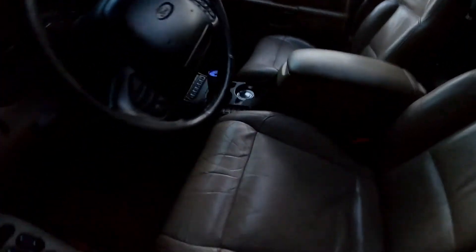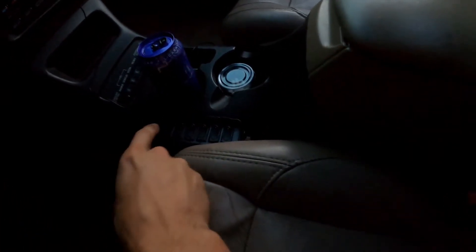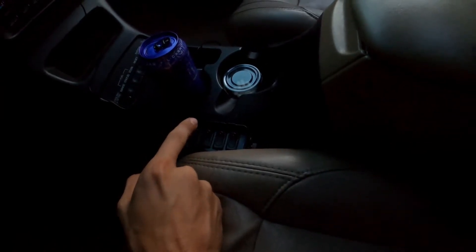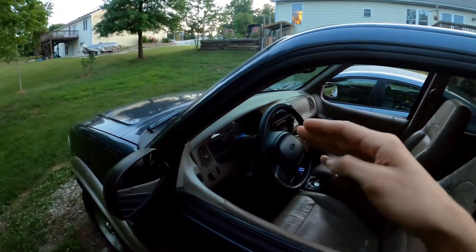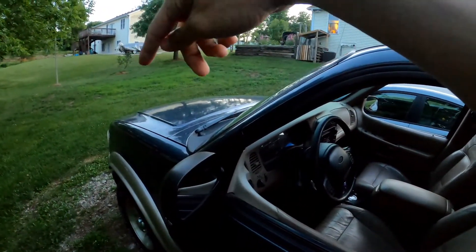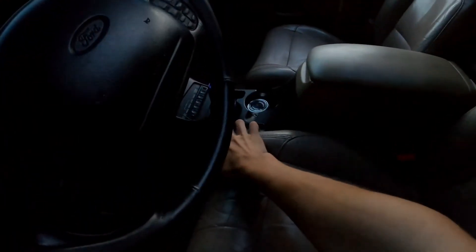I'll flip them on real quick and show you. I have a switch box in here — for right now it's just kind of wedged in the seat so I can pull it out and move it around. The front switch is the front strobes, rear is the rear. I also put in a headlight flasher but it's not fully working because I need another relay — the headlights on this vehicle all run power and controls to one and daisy chain to the other, so they need to be on separate relays.